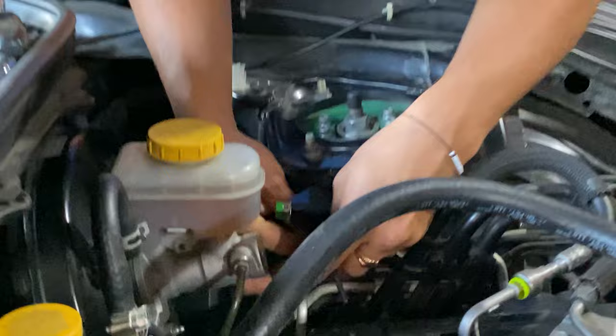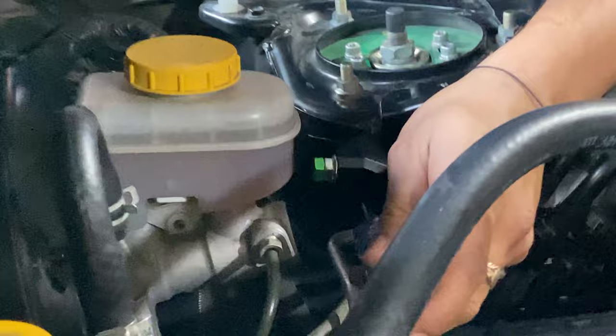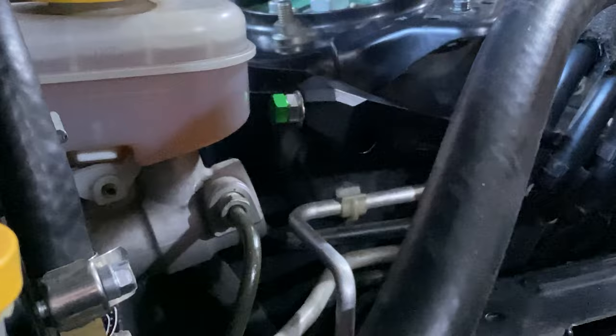That second hole might already be threaded — we'll find out. Poking through the little plastic cover makes it kind of difficult to get to the hole for it to thread in, but a range of screwdrivers kind of helps — just to push that hole properly so the cover is fully pushed through. Then you can thread it in by hand. I like to thread it in by hand first, that way when you drop this down you know it's going in properly and not cross-threading.